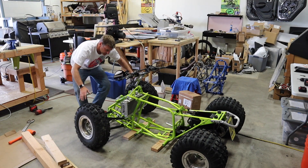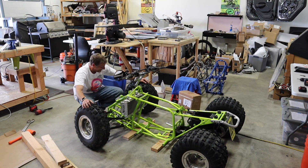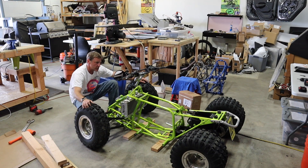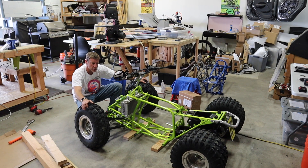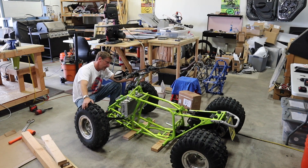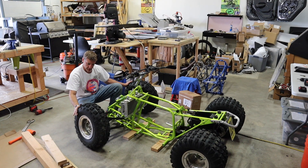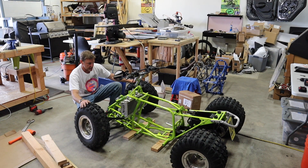You don't need to do this — it's like a badass hot rod though. It's kind of cool to do once you get it all together, just to see if anything binds or hits, especially that exhaust. A lot of times the caliper — I had another guy message me a couple days ago and he said his standard caliper is hitting his exhaust, which if it's spaced out enough it shouldn't, but it was. So this is a good exercise just to see how that's going to work out. And you can see the increase in toe when you really bottom out, because these tires are even more in.